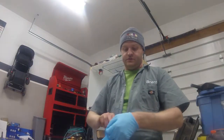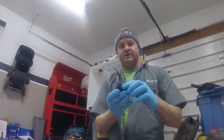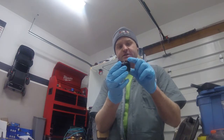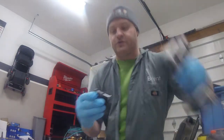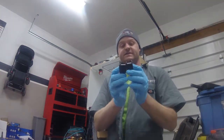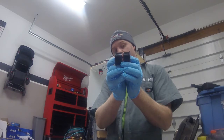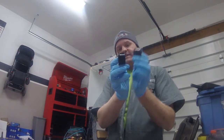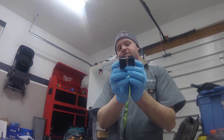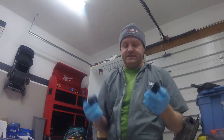Time that we are going to work on our bushings. Between these two bushings, we want to get our drill bit to drill through. In some cases, and in this one for instance, you'll find that the Energy Suspension bushings sit about that far apart in the hole. The Zerk fitting is centered on this seam here. So in this case, drilling really did no good, or was pointless, I should say.